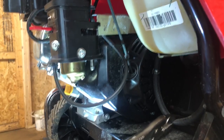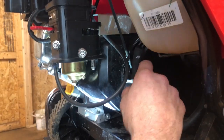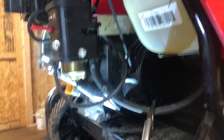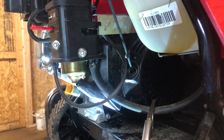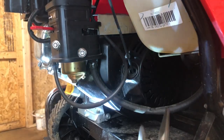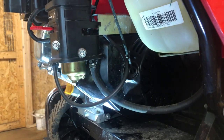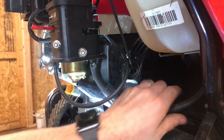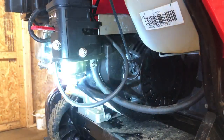Tightening down with a 10 mil. I like to always hold out on the end here and do them back and forth — don't get carried away going one side too far, just jump back and forth and give it a bump until it kind of stops and you're square. Now we're ready to get this thing down and see if it fixed the issue after we put our fuel line on. Bring our little clip back up. Make sure our float didn't stick or anything — got about a half a tank of gas and it should be rather fresh.